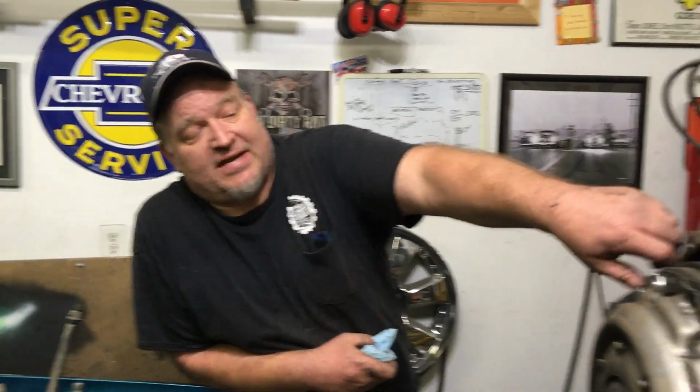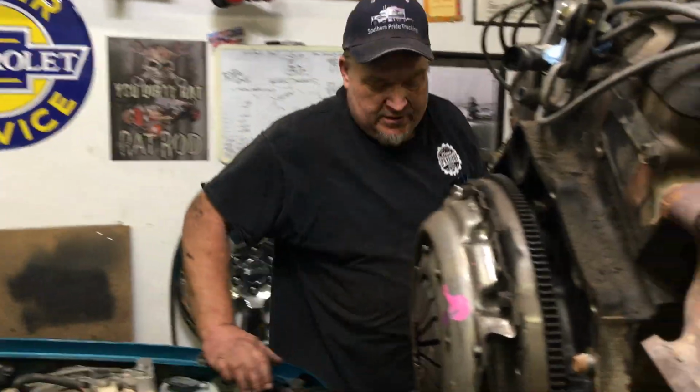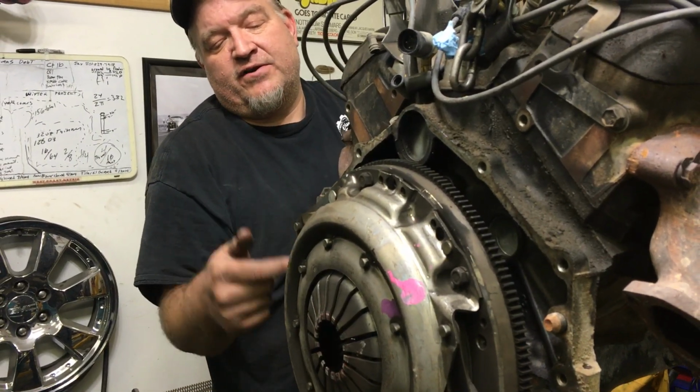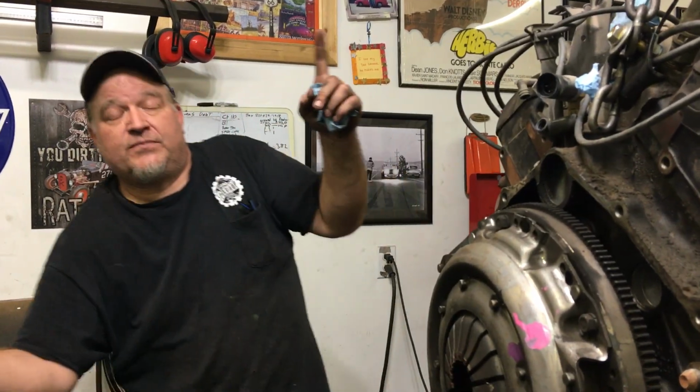Second way people get that bolt out is, so there's 6 bolts total here. You got 2, and these 2. Now, the way to get these 2 are from underneath, and these 2. You get a long extension, and whether you gotta do 2 or 3, you get a wobbly, you can get in there with an impact, it's nice and quick. A lot of people want a wobbly for this. So, that being said, you gotta go the opposite direction of what I do. I tilt the motor this way, pull it out from top.